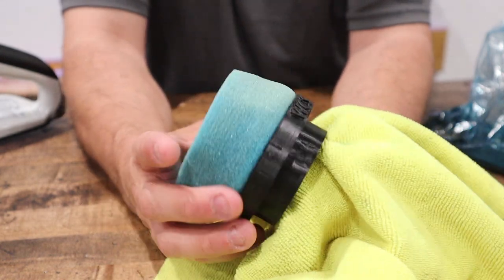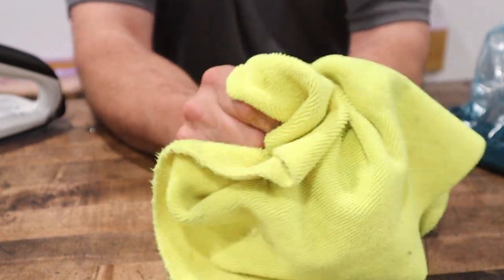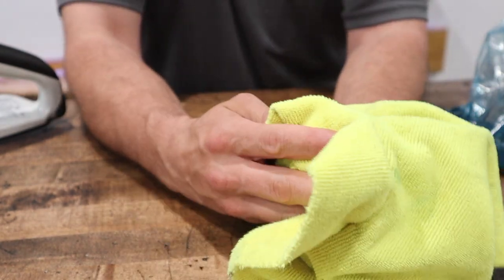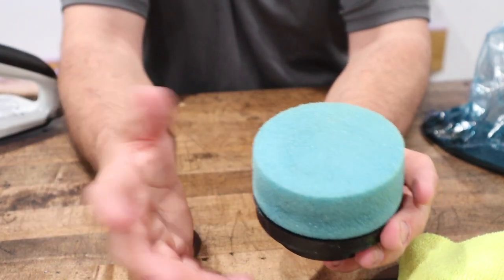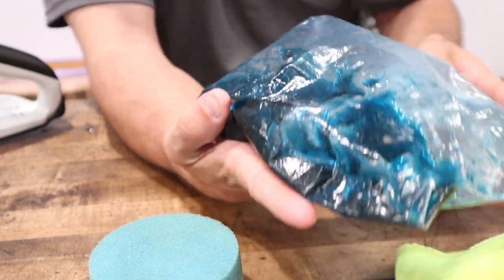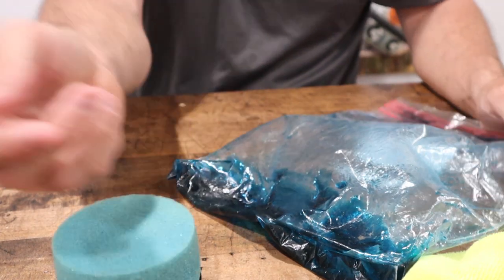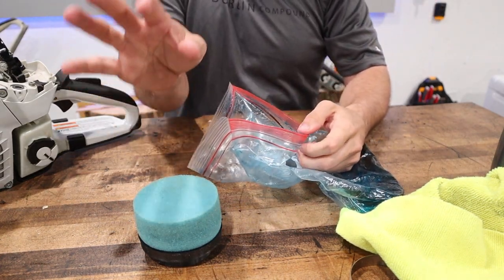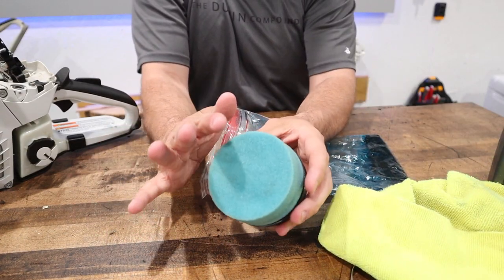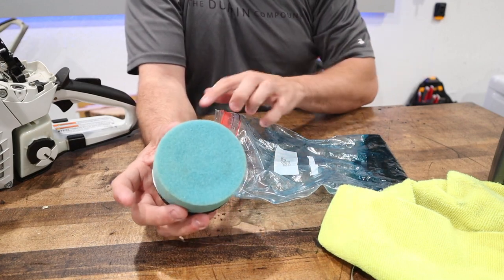Even after washing it, it's still nice and blue — it definitely still has some oil in it. But now that we've got it completely dried out, you can even blow it with an air compressor if you want. You're just going to make a mess with a pre-oiled filter like this — you're just going to blow the oil everywhere. I've already used this bag a couple of times so it's got some excess oil in the bottom. I've done this with a couple of different filters, a couple of max flows, so I have some oil built up here and don't necessarily need to add a bunch. But if you're taking a completely brand new filter that has no oil in it, you're going to put a decent amount of oil inside. It's not going to be just a couple drops — you're going to need a lot.